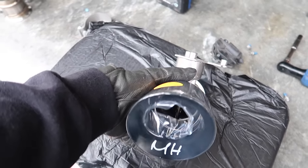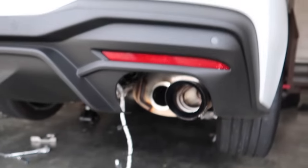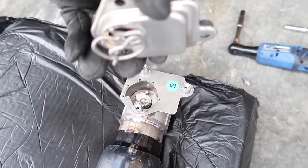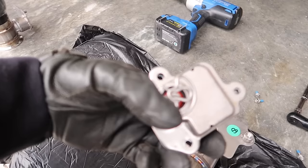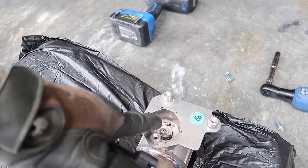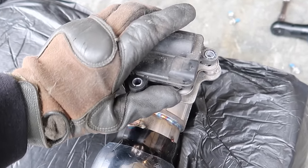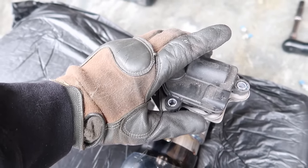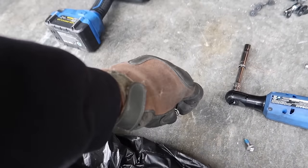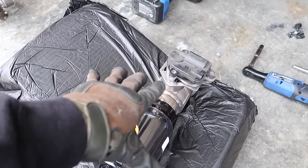Word of the wise — one actuator side at a time. You want to start with the open position with the butterfly valve, oriented on the passenger side kicked out. Grab it all as one piece from one end to the flat end. That's going to live inside the notches. It should just slide right down in there — you might have to give it a little turn. Take your 10 millimeter bolt with Threadlock already on it, install, and move on to the other side. Make sure your butterfly valve is open when assembling.